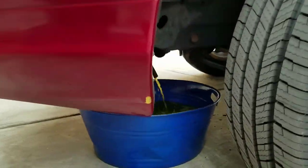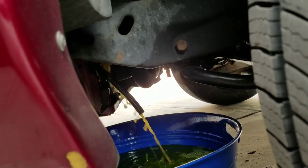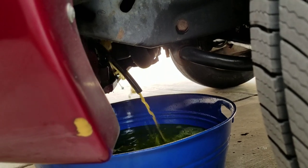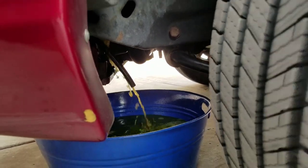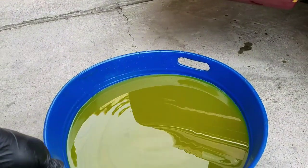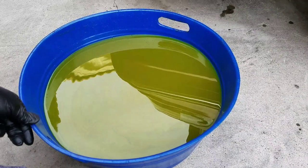So I put that whole gallon in, and it's still coming out right now. I'll show you what it looks like. You can see it still has a lot of green tint to it, and that means it's getting all the old fluid out — so we're flushing her out. Once it drains down, we're going to go ahead and fill her up. To show you guys what came out — this is what came out — that's basically everything that came out plus the one gallon we put through to flush out most of it.